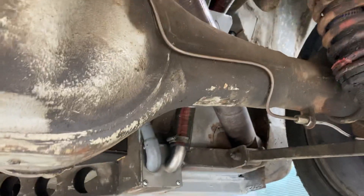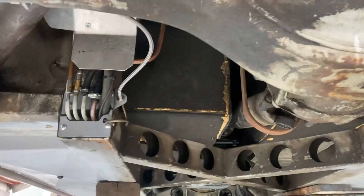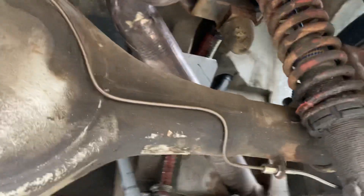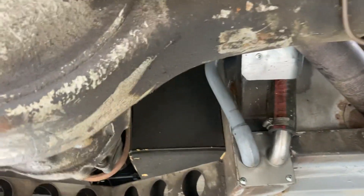If we're doing runway work and trying to hit big speeds, I've got some better pads for the front — Ferodo, sort of halfway between race and road. They're funny because you stand on them and nothing happens, and then all of a sudden you're stopping really quickly. I think they have to get to around 400 degrees before they bite.